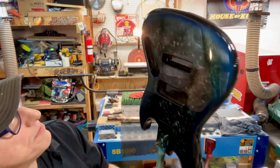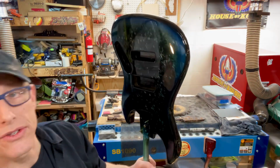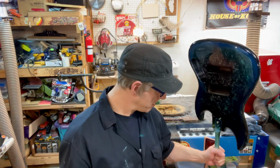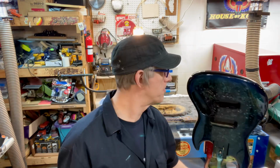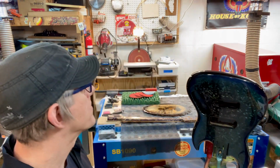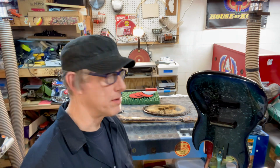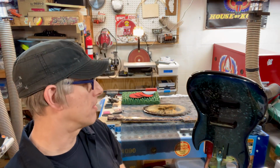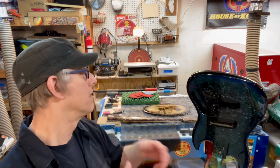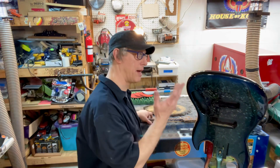So this is going to have to be sanded. If there's enough clear on it, Eli's done a really good job spraying it. I'll wet sand it, and we'll see how that comes out, and see if we need to do another round of clear. But right now, there's 3 coats of clear over the carrier coats that had all the candies in them and the paint. So that's where we are now.